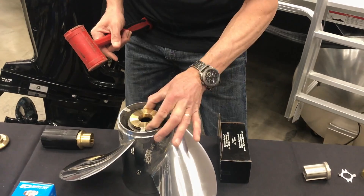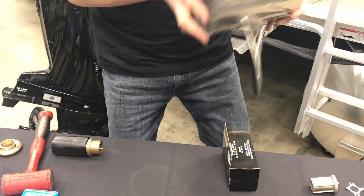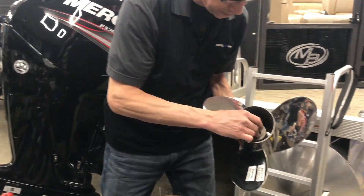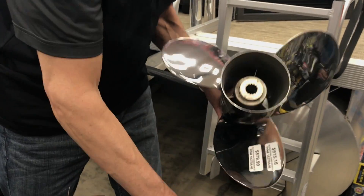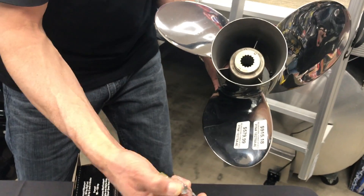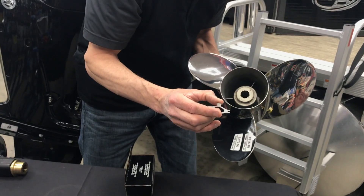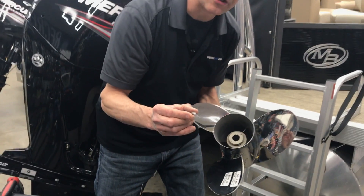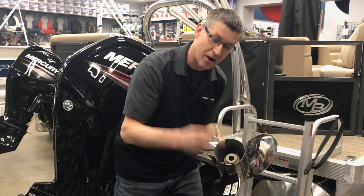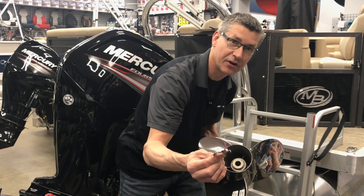This is kind of like my installer tool with my hammer. I insert it that way, now the sleeve is all the way in, the thrust washer is seated properly. Now I can add my insert, put this onto the prop shaft, then add my locking collar and nut and just torque it nice and snug. Don't forget to lock your fins — if you don't and you put the boat into reverse, the propeller will unscrew your nut right off if you don't lock the wings or tabs on. Very, very important to do.